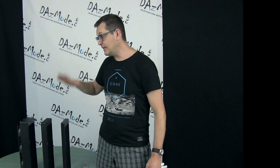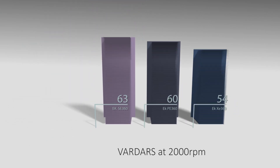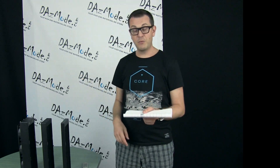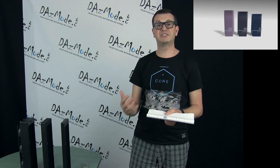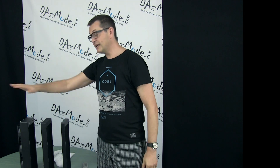Now with the triple radiator and 2000 RPM fans, we start seeing clear differences between all units. Between the smallest SE and the medium PE I got about 3 degrees. Between SE and the XE we get a healthy 9 degrees difference, and 6 degrees between PE and XE. So with fast fans and a really hot system, the thick XE radiator is an absolute no-brainer and totally worth the money. For any other scenarios, the difference becomes less meaningful and it's hard to justify the extra cost.